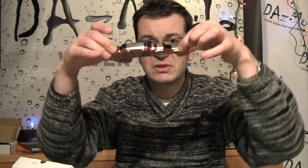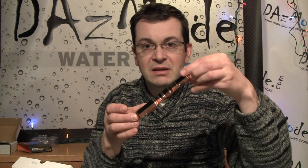When you put the card on the block to cool it off, there are no obstacles — it just sits on it and fits perfectly. But what happens all the time with GPUs is that EVGA or ASUS decide to make some improvement, and they move one single capacitor or other electronic component two inches away on the board. When you try to put your block, you hit an obstacle and everything doesn't fit. The compatibility issue for GPU cards is the most annoying and difficult subject when trying to water cool your card. So again, do yourself a favor — if you have an idea which card you want, first check if you can actually water cool it.